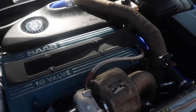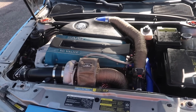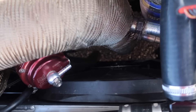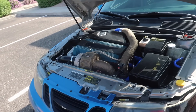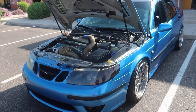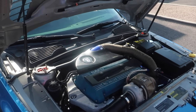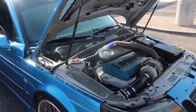What does that kit come with exactly? It comes with everything you see here: the turbo, the downpipe, the wastegate, all the associated piping, oil line, coolant line, the radiator fan, the fan shroud. It's designed to be a bolt-on kit directly for a big turbo. It needs supporting mods like pistons, especially for the G7 guys out there. But it's a great kit — pretty much bolts straight on. This was actually the car that the kit was designed on and developed for. The manifold and everything was designed in-house at Krona up in West Virginia. Shout out to Matty.